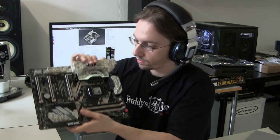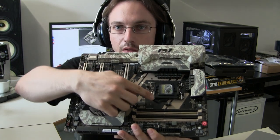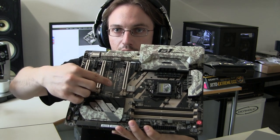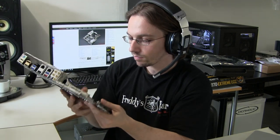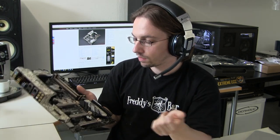The M.2 slots are positioned nicely. The first one sits above the first PCIe Gen 3 x16 full-size slot, and the second one is right underneath it. Both offer up to 32 gigabit per second of bandwidth, allowing you to build a seriously fast workstation — especially with something like Samsung's 950 Pro M.2 SSD, which gives around 2 to 2.2 gigabytes per second of raw throughput. That's really nice for video editing, photo editing, and storage-bandwidth-heavy workloads.